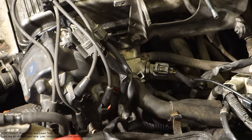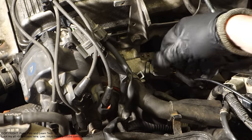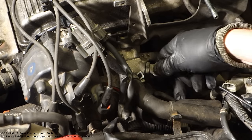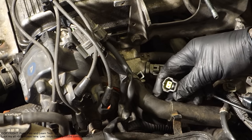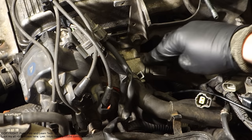And this is the sensor, and the first step is to take this sensor's cable out. We need to press the central area in with the thumb and then pull out. First press and then out. This is Toyota's normal way. And now it opens, and there is this connector, and when I press that, it opens. And there is then this sensor.